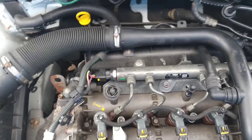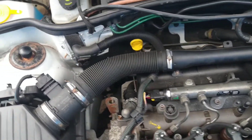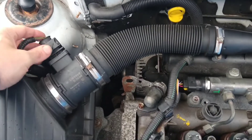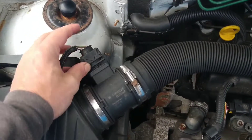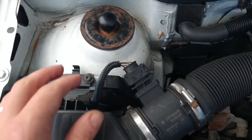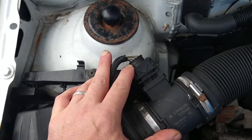I have changed the scan tool for a Foxwell, and it must update quicker — you do see the pressure whilst you're cranking. I had some suggestions and thanks to everyone who had suggestions. The easiest one was to unplug the MAF sensor, so I did. It still didn't go. However, when I plugged it back in, I had zero grams per second, because a few people — Miles was one of them — pointed out it was 40 grams per second with the ignition on and 40 grams per second when I was cranking. And that's not right.